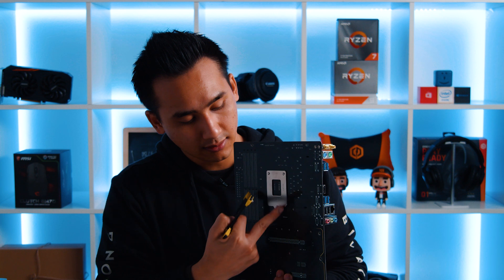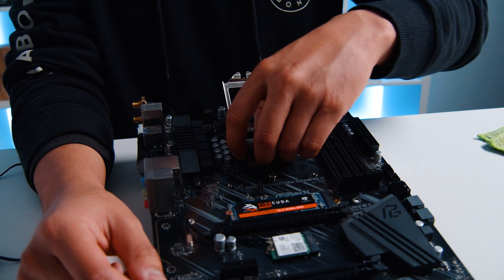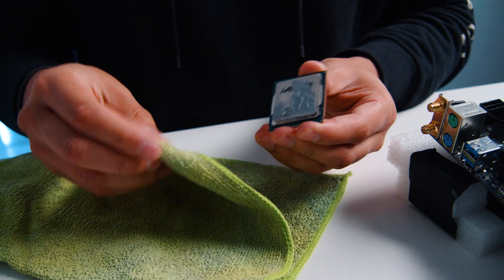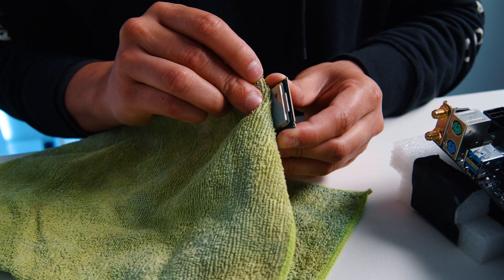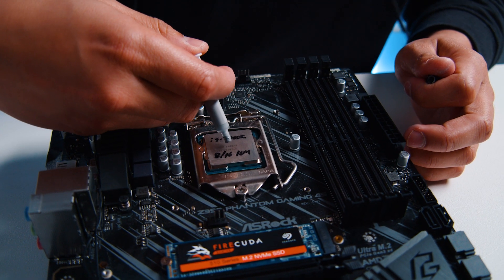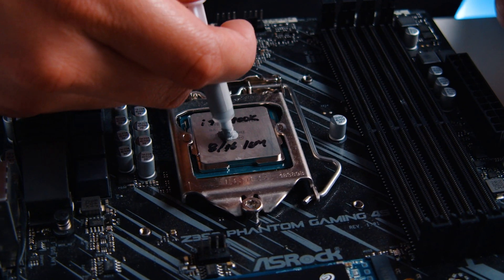On the back, all you do is put it around the CPU. After that, wipe down the CPU. I recommend that you take out the CPU, hold it on the edges, and just wipe off the extra thermal paste. Then put the CPU back into its socket and reapply a very small amount of thermal paste — about a bean size, like a little bean. When you put down the CPU fan, it'll actually spread out the thermal paste evenly.